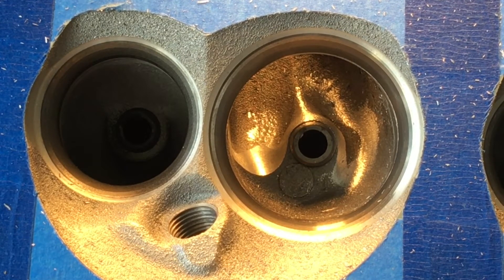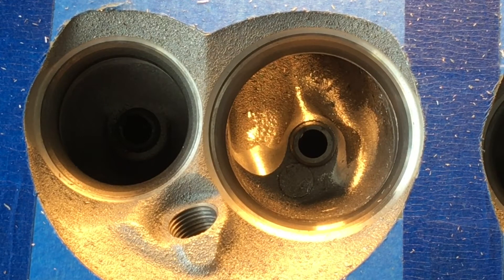I just wanted to share that as a next step when you're starting to port these cathedral port heads, if you choose to take the swirl ramp out. As I've said previously, you can vastly improve the flow of a cylinder head and not take the ramp out. So if you guys are starting a first-time project or building like a daily driver on a small cubic inch, you do not have to take that swirl ramp out — but if you do, this is how you take it out without hurting anything.